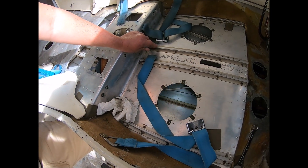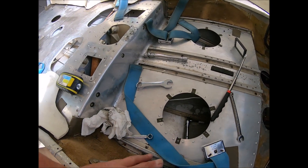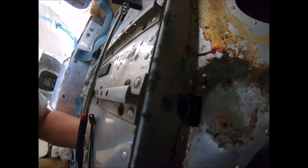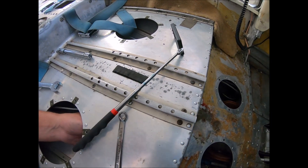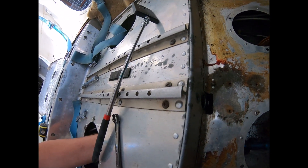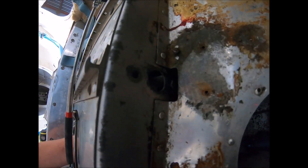The mechanics would have said put a bigger hole than that here. The fuel valve's out now — it was hard. Here's what you got to do: you're gonna work through this one and lean over and look through this one as you're going at it. Only two bolts hold it on. I used a ratchet out here for the top one and a wrench under here, and then for the bottom one a wrench out here and a ratchet down here.